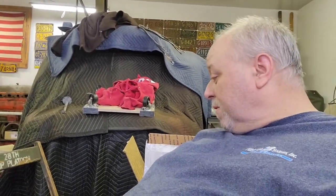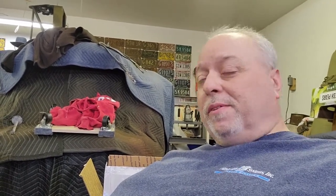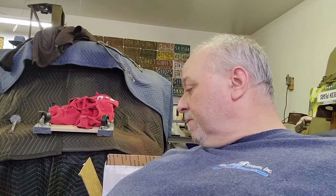Well, Bat fans, I think we've come to the end of another road. So the wiper motor thing didn't pan out. The generic 6-volt wiper motors that Sean got are from a Model A Ford, but they're a universal type. The pivot shaft on them is about 1/4 inch in diameter, and the CCKW wiper arms are like a 10, about three sizes smaller. We tried brainstorming a couple of things, and without making it messy, it's probably not going to happen. So, yeah, we're going to call it quits on that one for a while.